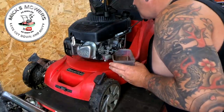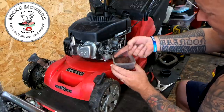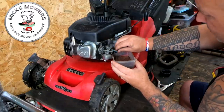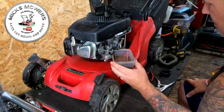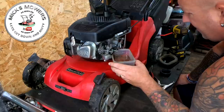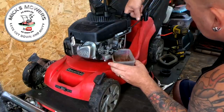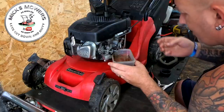What's he done there then? The tank is nearly full. I'm not getting any remnants of any fuel at all - this is all saying water to me. We'll have to sort the carb off anyway because we have got this amount of water in the system and the tank is full of water. There is fuel in there but I can smell it and it doesn't even smell like petrol to me. So we're just going to drain the entire tank out.